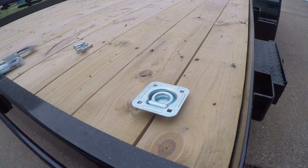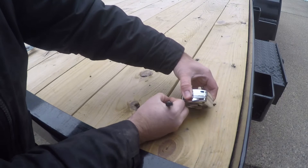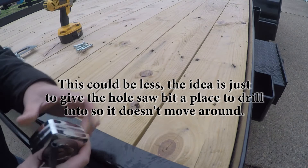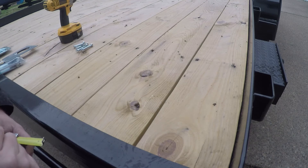I'm going to put the D-ring roughly about right there — that'll give us plenty of clearance underneath for the backing plate and bolts. What I'm also going to do is mark over about a half an inch, and that's where we're going to actually drill our hole. It is going to offset the D-ring slightly, and the only reason I'm doing that is so the hole saw arbor bit has a place to go so the bit isn't going to want to walk around while I'm trying to drill. It's not going to make a difference for the mounting of the D-ring — it's just going to make things easier when I drill the hole.